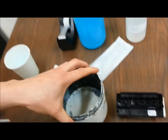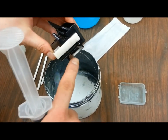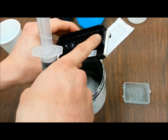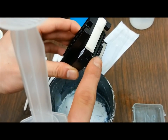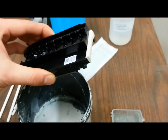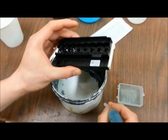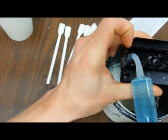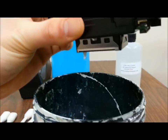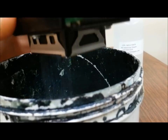Get your little waste dump container and lift your printhead. Depending on where these two contact ports are, raise it and slope it in the opposite direction — so when you do the waterfall, all the excess liquid floats away from the slots. As you can see, my slot is on my right hand side, so I'm going to slope it upwards toward the right, sloping downward on the opposite side. Start with the white — put the rubber tubing over the nib, reinforce it by holding it with your other hand, and gently apply pressure until you see a steady stream flow. It looks like an actual waterfall.